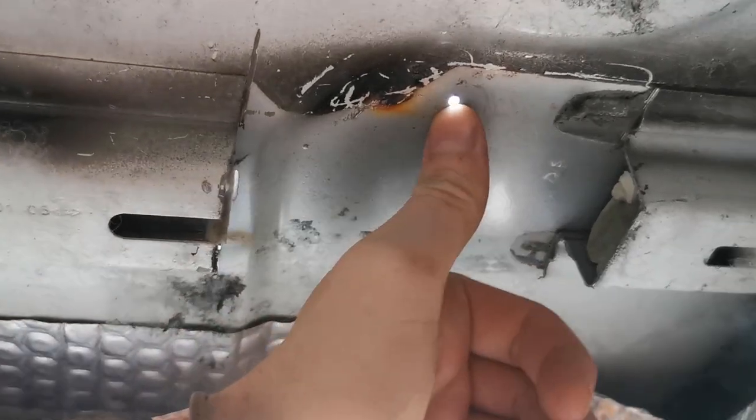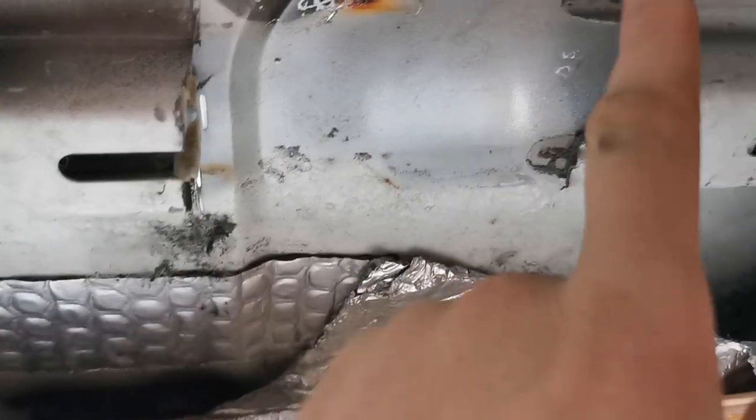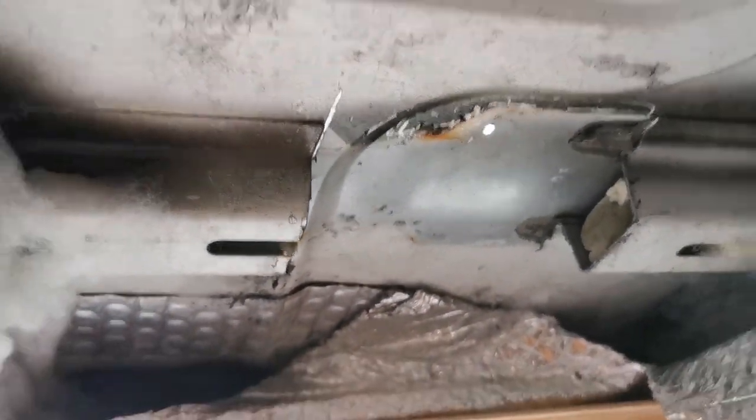There's the center, and I've cleared that beam out of the way. Now I can go on the roof, draw a four-inch circle, cut it out with a jigsaw, and that'll be the hole for the flue.